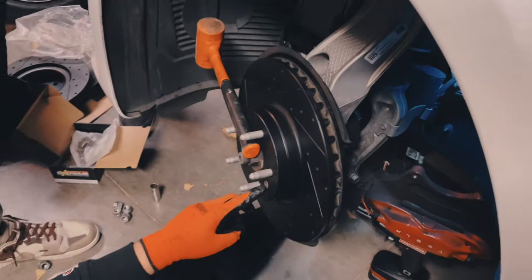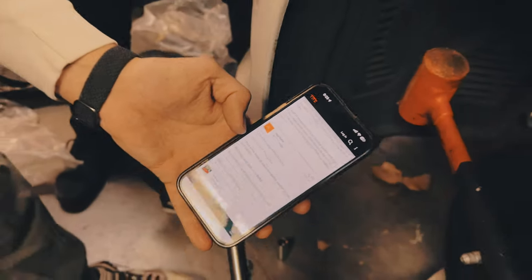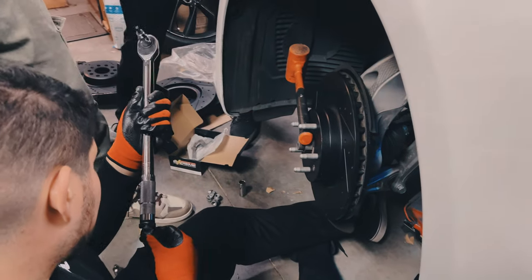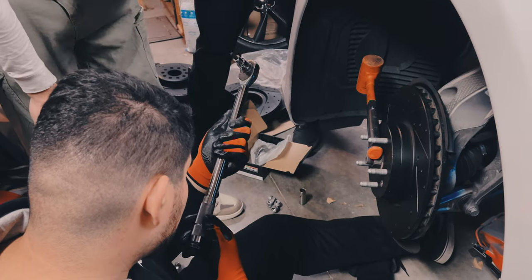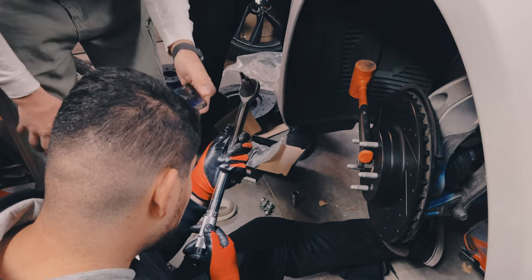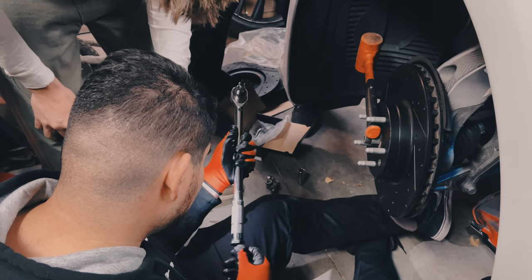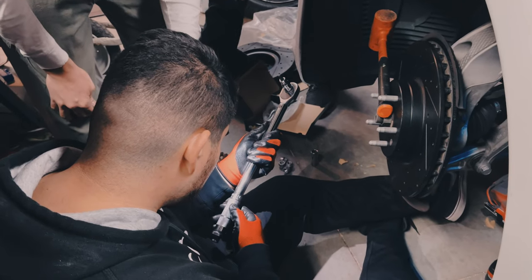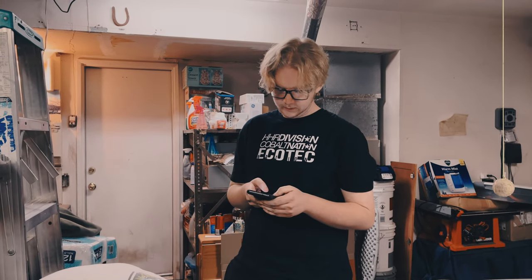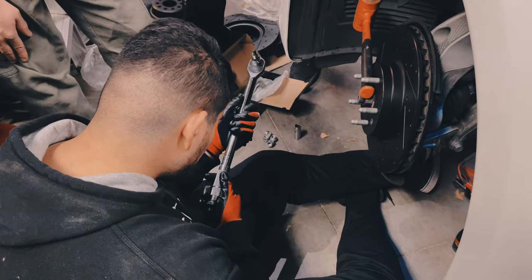Then I want to torque this to 120 foot-pounds. Yeah, tink. As it snaps. Oh, 17 newton meters? Yeah. 120 foot-pounds of torque. That's foot-pounds. How many newton meters? 17 for that section. So basically almost maxing out. Yeah, bro. Newton meters are right here. 120 for caliper and knuckle bolts, 17 for rotor hub screw, 42 for brake hose to caliper. That's like nothing. Who's torquing their brake dust shield?